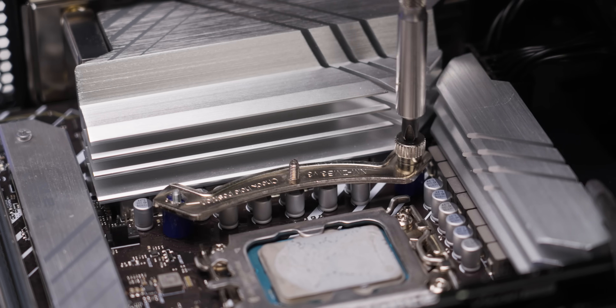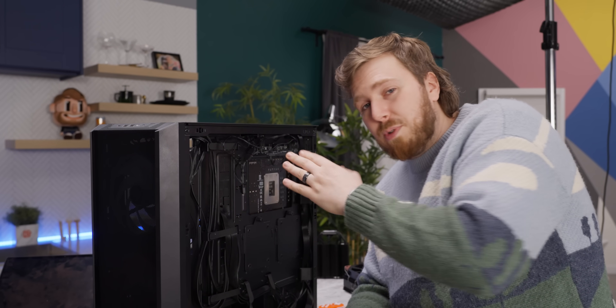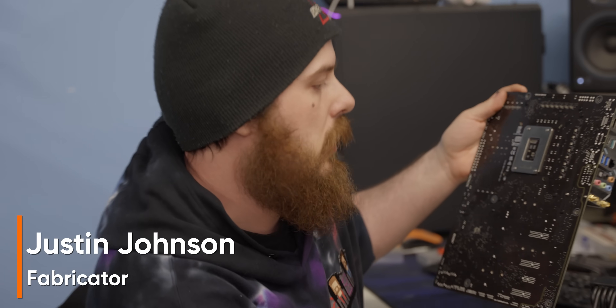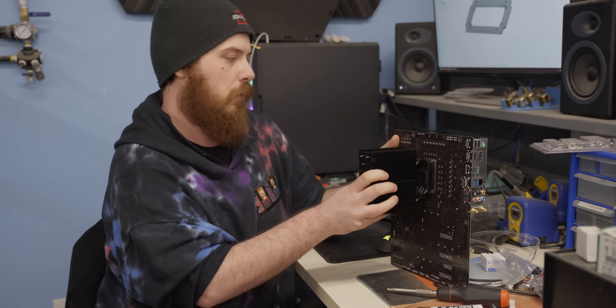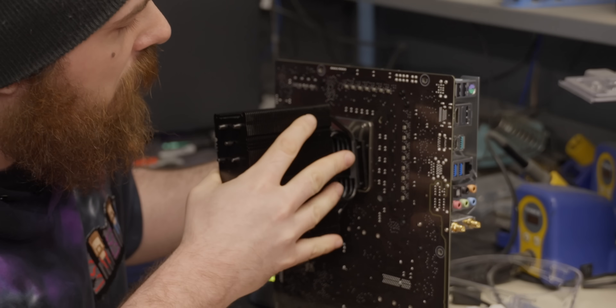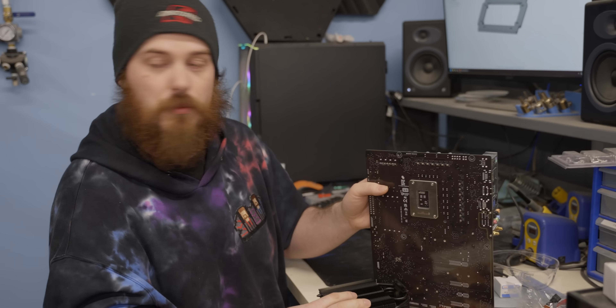So we need to get rid of the existing mounting hardware. The Intel socket backplate that holds the CPU retention arm on the front also prevents our second cooler from making direct contact with the back of the motherboard. So not only can we not use out-of-the-box CPU cooling parts, we're going to have to remove the backplate as well, which means we're going to need to make a custom backplate. There isn't really a whole lot of material on the ends to put bolt holes through, so we're going to have to make a new one out of metal.